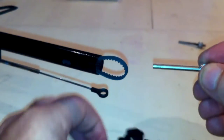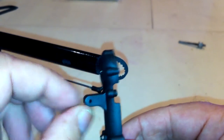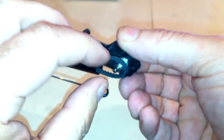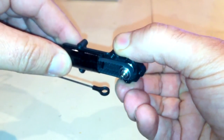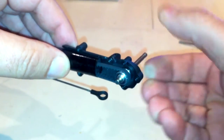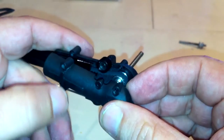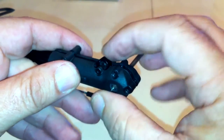That's quite easy to disassemble there. Now that shaft will just slide straight out of that bearing there. So I'll set that aside and grab my new one. And we'll slip it all back together. Now the half you need is the one with a little leg here. That will just go straight into there. Remember not to turn your belt. Put that onto there — you can just feel that clip into spot like that. Put our little roller back in. Rollers back in there. Set that back into spot.